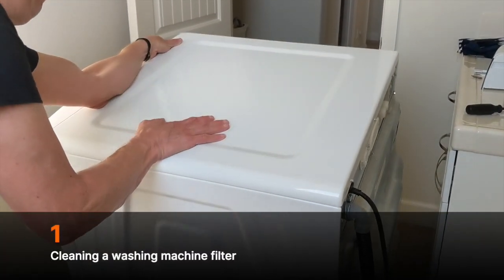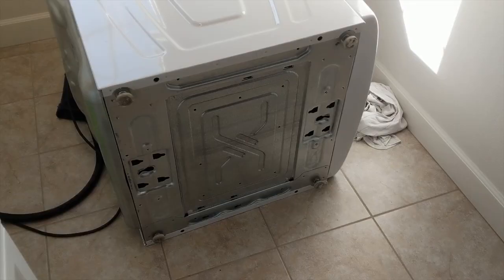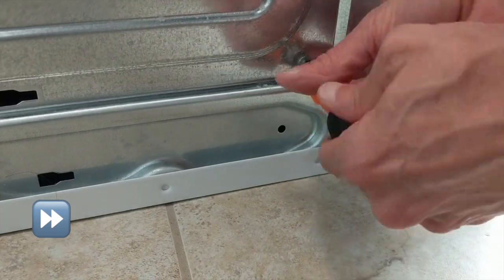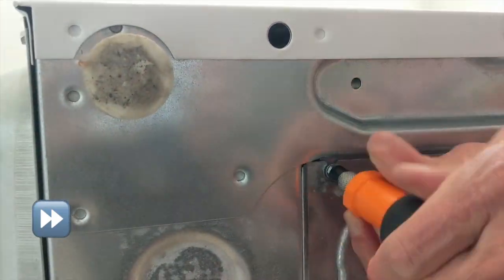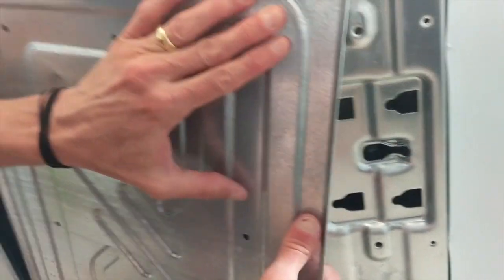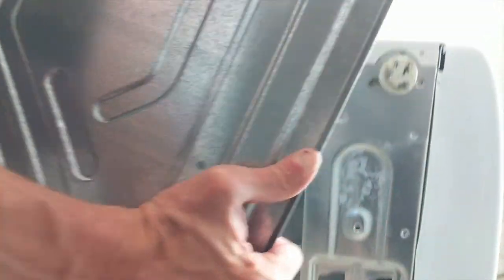First, tip the washing machine over onto its right side. I used 2 rolled up towels to prop mine up slightly so it wasn't laying flat. Now remove the 2 screws. Since these are hex bolts, I was able to unscrew it with a screwdriver that didn't have the bit installed. Now flex the panel slightly to bend it around the plastic posts, which do not get removed.